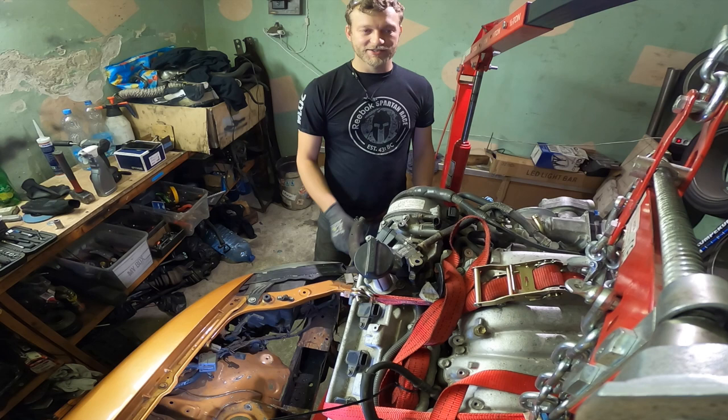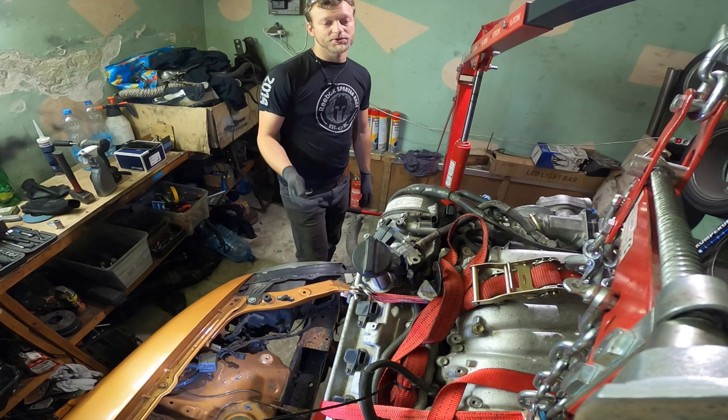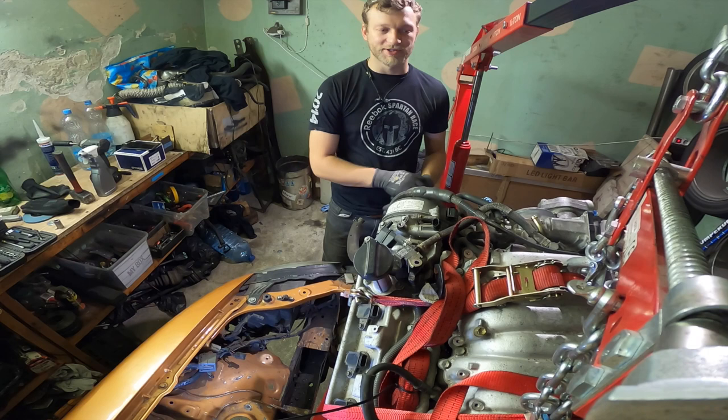This one, unfortunately, has really skinny rods. They were lightening and lightening the rods, probably for fuel consumption. But the advantage is it should be revvy, but I really cannot boost it. I checked it and there are like 30 more horsepower to gain and then a rod through the block.